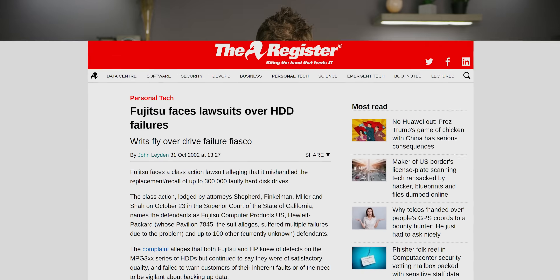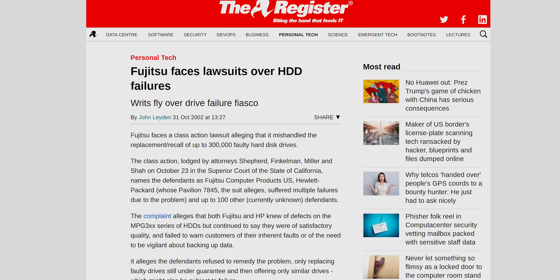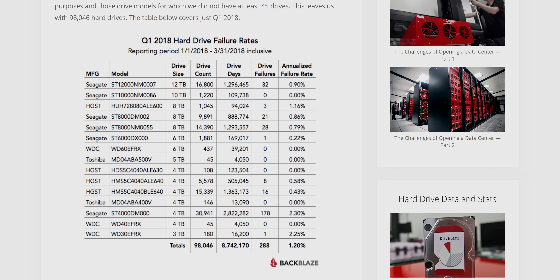As for mixing and matching drives — something you run into when you add drives now and upgrade later — some people actually encourage using different makes and models of disks, as long as they keep the same spindle RPM and the same claimed capacity. The arguments for this are that it reduces the risk of systemic failure affecting all units of a particular drive. Another advantage of adding drives over time is that they won't all be the same age. Hard drives tend to fail a lot early on, then very few, then ramp up significantly as they get older — so if they're all the same age, they'd all start to drop off around the same time. That said, if you've got known good drives, there is a performance advantage to using ones that are all the same when striping data across them.